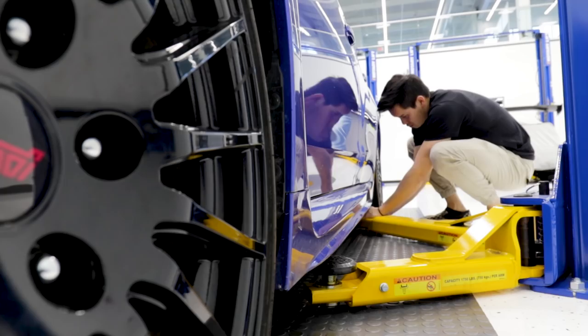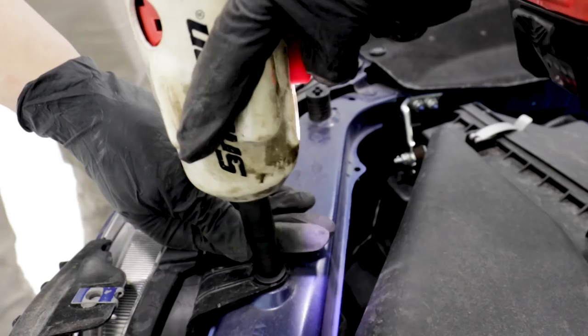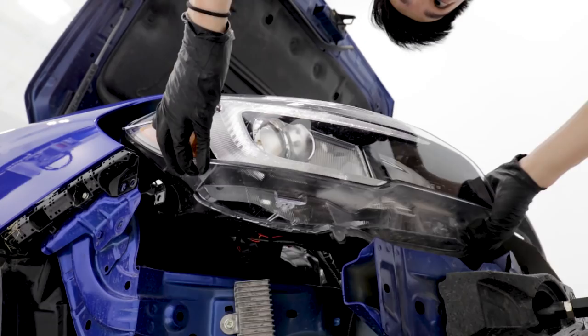So we're done with lunch and the Fortunato seminar. Let's get the bumper off of this car and the headlights installed. For those of you who have never taken off your headlights before, I'll go through a quick little demo for you guys. I know I have a video out there — our Morimoto Retrofit Kit install already — but I'm gonna go through real quick and show you guys what you need to do. Obviously I already have the bumper off, so if you've gotten that far, then you're gonna look for these two 10mm bolts up top on the headlight.